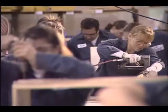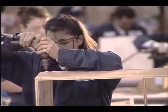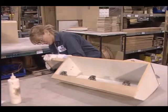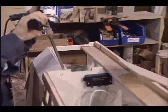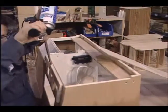Rather than assembling the cabinetry in the van on the assembly line, we use a method we call modularization, whereby most of the cabinetry and other woodwork is pre-assembled in the wood shop. Modularization allows more consistent quality through the use of jigs, templates, and a more ergonomically designed work area. It also takes much less time than assembling inside the vans on the line.